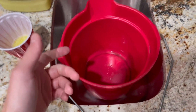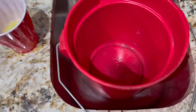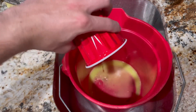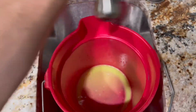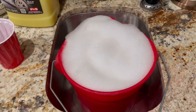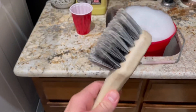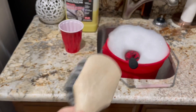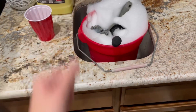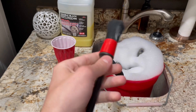It's a very good idea to have a dedicated wheel bucket. Look at all this stained brake dust in there — that's not coming out. So you don't want to mix that with the bucket you're going to use to wash your paint. I pour some soap and hot water in there, and once it's filled up I throw in my wheel cleaning brushes: my wheelbarrow brush, my soft horsehair face brush, my tire brush, and my horsehair smaller detail brush.